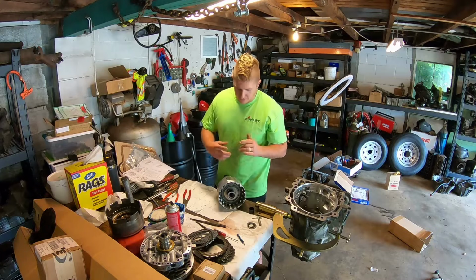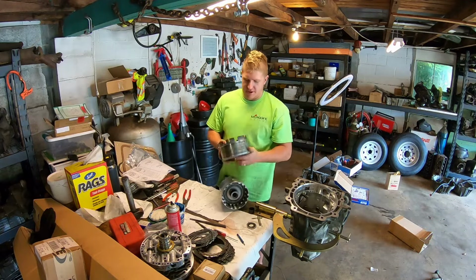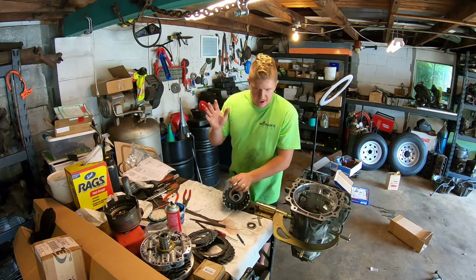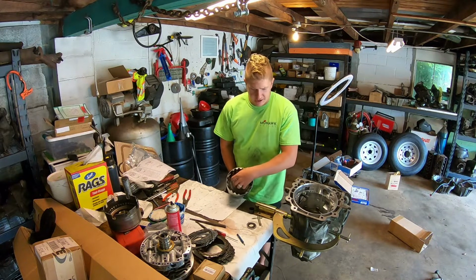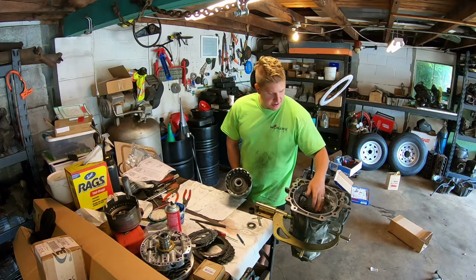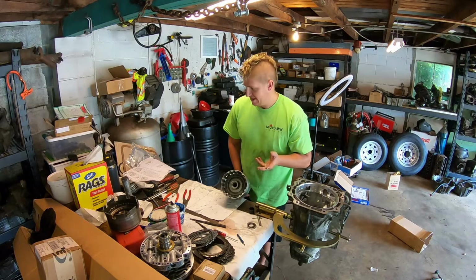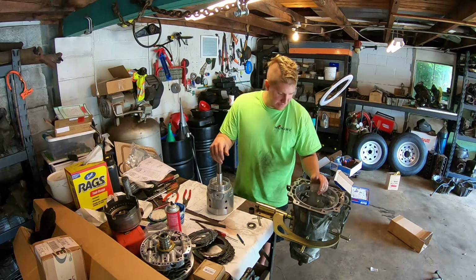So I took it all back apart, went through, and got those replaced. I got the reverse input drum, new bushings installed, new clutches installed. That's all ready to go now. I am waiting on my Z-Pack 3/4 clutches to get here so I can finish assembly of the input housing, get that installed into the transmission, and install the reverse input housing. Then that'll be pretty much it for the power transfer assembly in here.